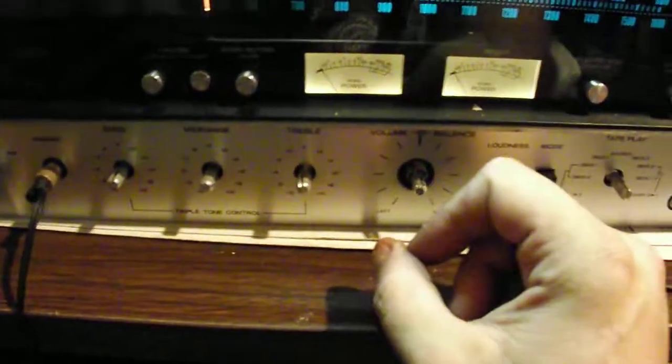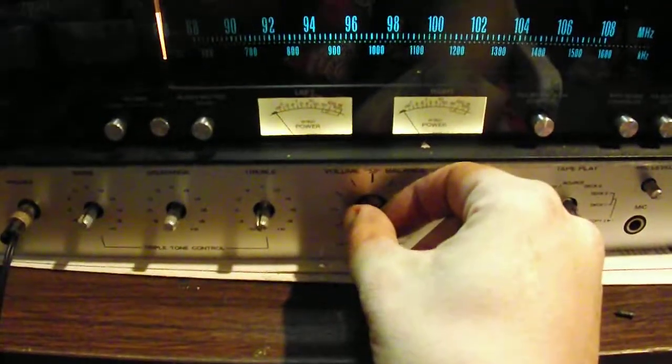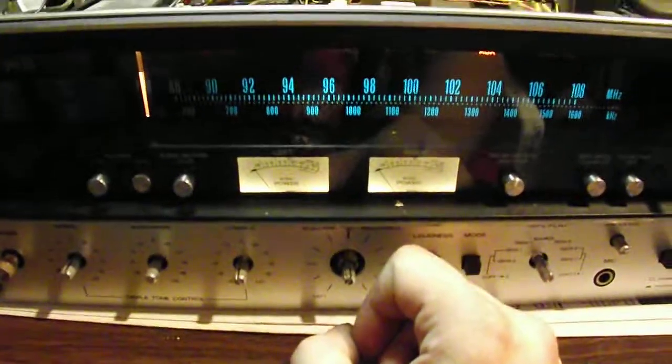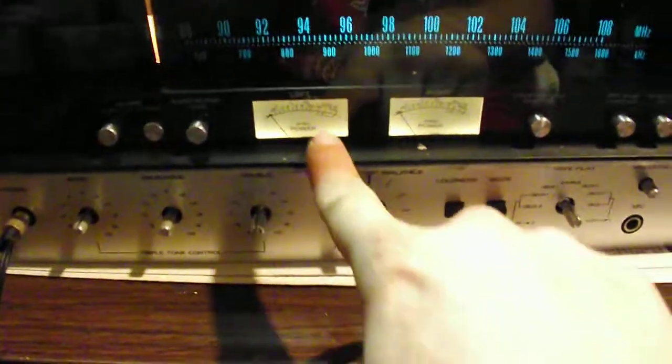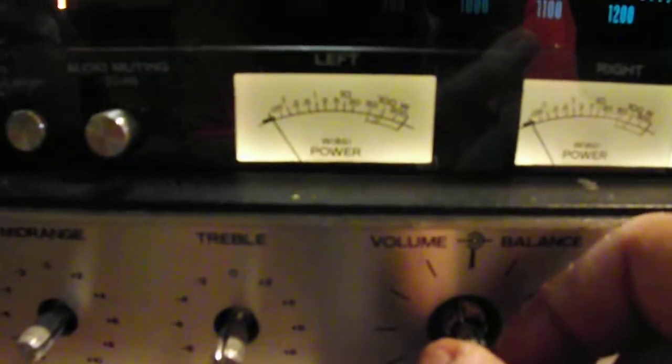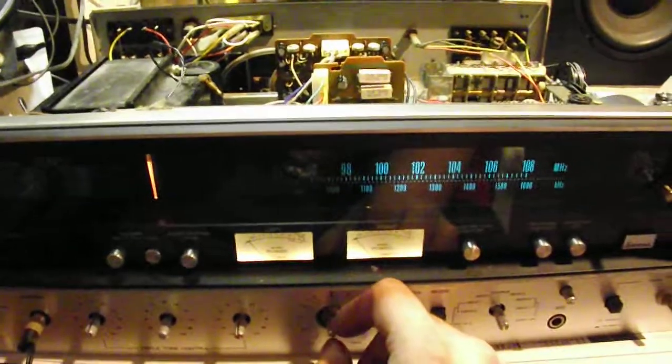I can't really push it now because I've got the speakers sitting literally right in front of me and it gets really deafening. I think these are rated 89 decibels per watt. But with the 4-ohm speakers and this listing 8-ohm power output, you're putting out a heck of a lot more power than the meters indicate, just because of Ohm's law. You can see that light went out again — I've got to get in there and really mess with that. But it's finally working, and I'm so happy because I can finally get paid for this.